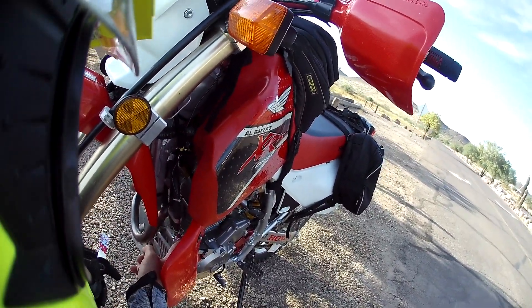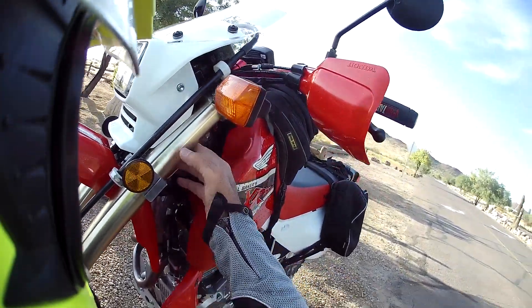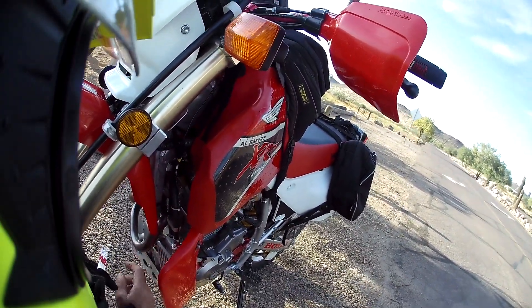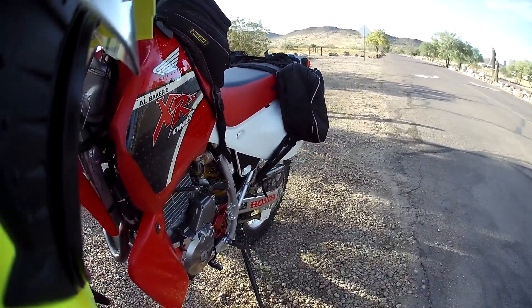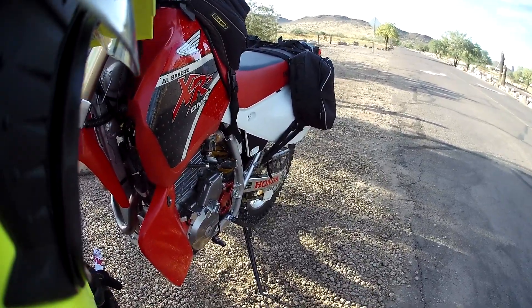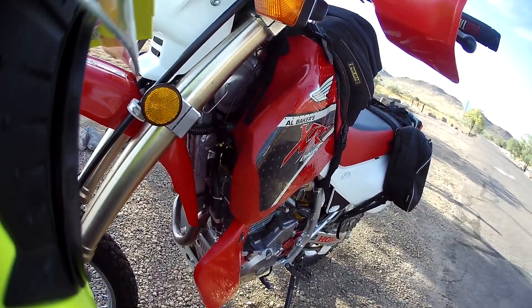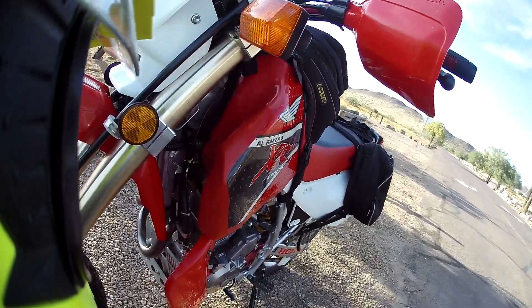If I mount it on the side of this on the outside, and if I mount it on the side of the DR-650, I can replicate it pretty close. These sensors are supposed to screw on to like the spark plug and stuff for the head, but they're just a different size — this is a 10 millimeter for this one. The Suzuki's a 12, and they're like 35 bucks. So this is the cheap way of doing it — side of the oil cooler is side of the oil cooler. That way I can use the same sensor and the same Trail Tech Voyager unit on each bike.